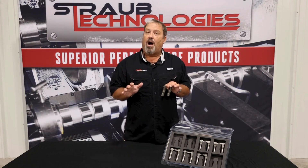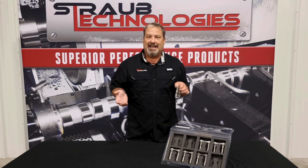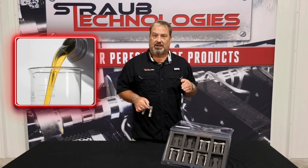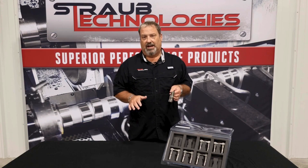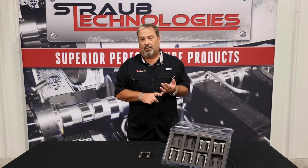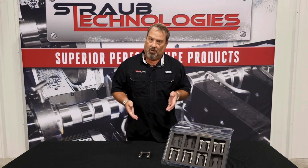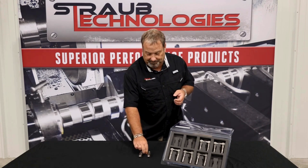Now let's get to the three main problems I see on the internet. Back in the 70s we were all told that for building a race motor you've got to use 20w50 oil. Well, back in the 70s we also had a phone book and rotary phones — those don't exist anymore. Oil has come along. If you look at the API — the American Petroleum Institute — and the changes in oil from the late 80s and early 90s to present, it's astronomical. The additive packages today are far superior. No OEM among the big three is using 20w50 — some have serious hot rods making 500 to 700 horsepower with hydraulic roller lifters and they're not using 20w50.